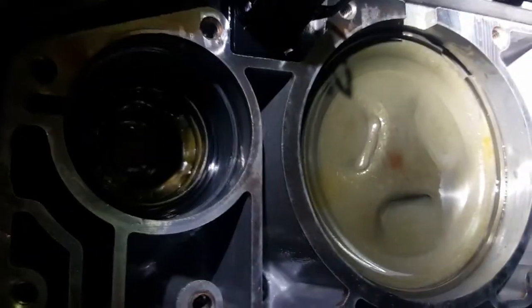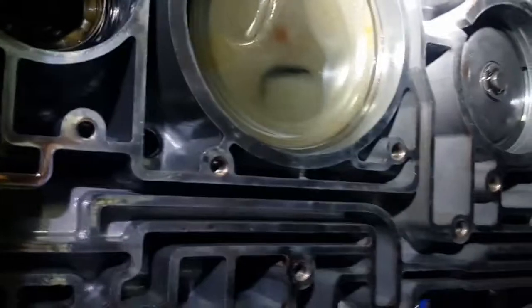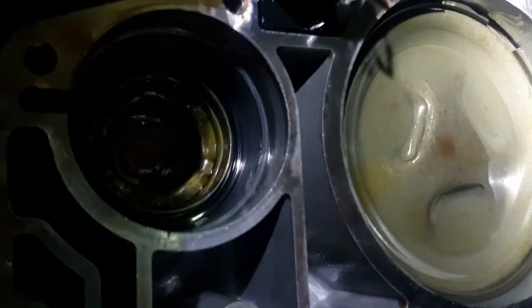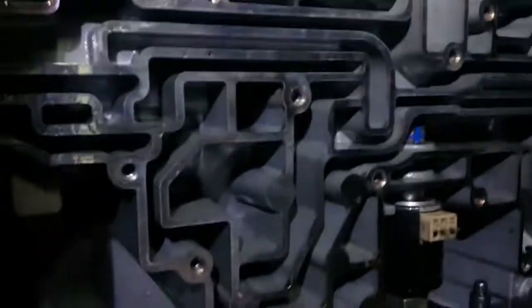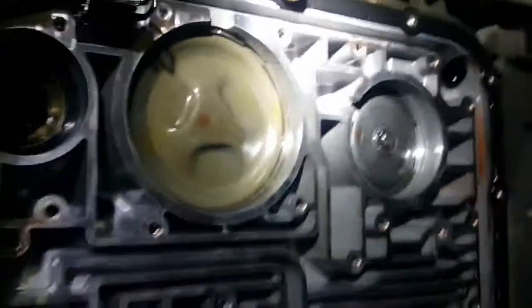Also in mine, the two-three accumulator - when I pulled off the valve body, the spring and the little retainer clip fell off and the spring was broken. I'll show that in a second. Otherwise, everything else on here looks fairly normal.